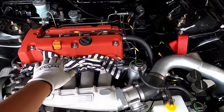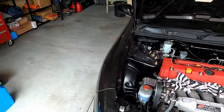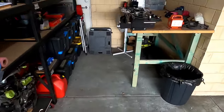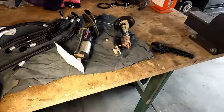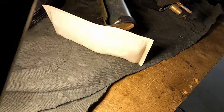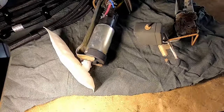The fuel system's completely out — just blocked off the injector holes with some rags at the moment. Pulled it all to bits, been quite interesting having a look at things. So first is the lift pump filter sock — that's actually relatively clean. I imagine it's a fairly coarse sock and it's not really going to pick up much, but it hasn't really discoloured at all.